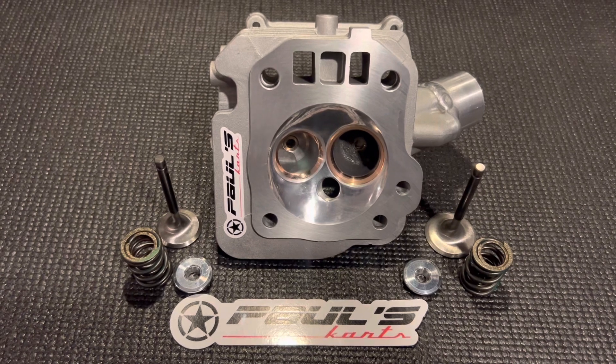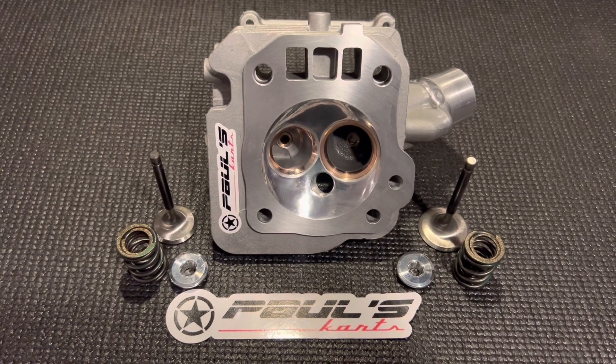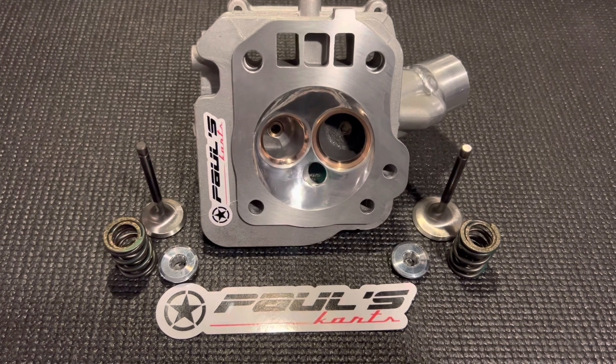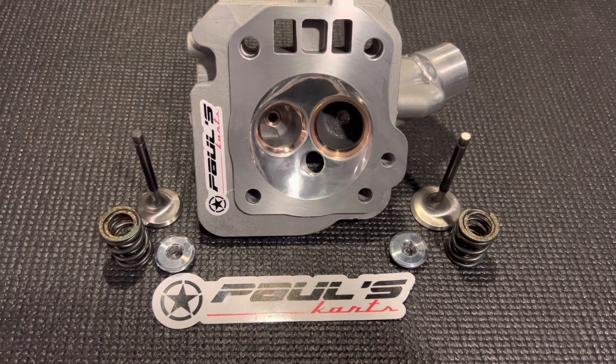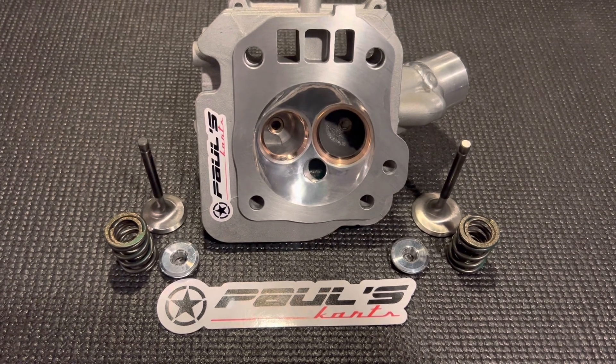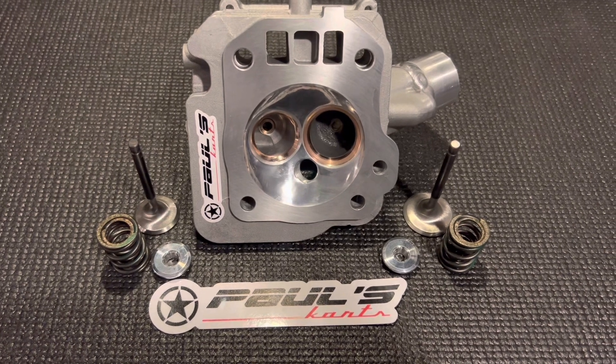When you do that and then add the Pro Comp upgrades — like the welded intake tube, the epoxy port, the Moldstar 90 seats — and do upgrades like titanium retainers and dual coil springs, this head becomes like a real monster. We would use this type of cylinder head on a three-inch crate engine.